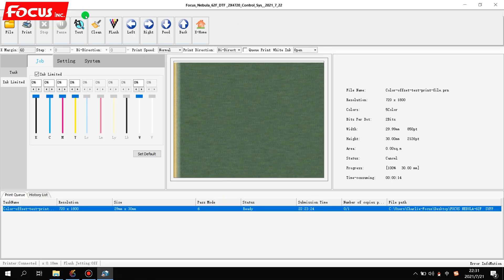When we go to the software and go to Test and choose vertical calibration, we check if the print head — white print head and color print head — have good alignment and good physical installation. If we cannot get a good vertical calibration, we cannot get good printing quality. So we go to choose vertical calibration.